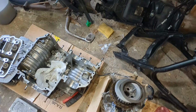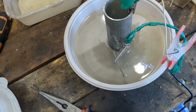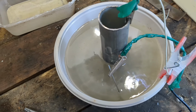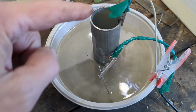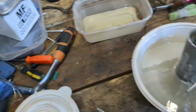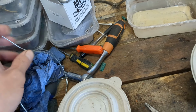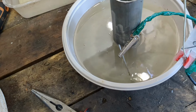Back. You can see the fibre ones there. The steels I give a bit of a scrub down. And I've come up with a slightly ingenious way of doing it, because I've noticed that you do tend to get the best electrolysis when you're closest to your anode, to your positive element. So it's a big donut, so I've made a donut. And what I've done is chopped off, you know, centimetre lengths of wire just between each layer, sandwiched them up, and I'm just going to leave it, and that will do me